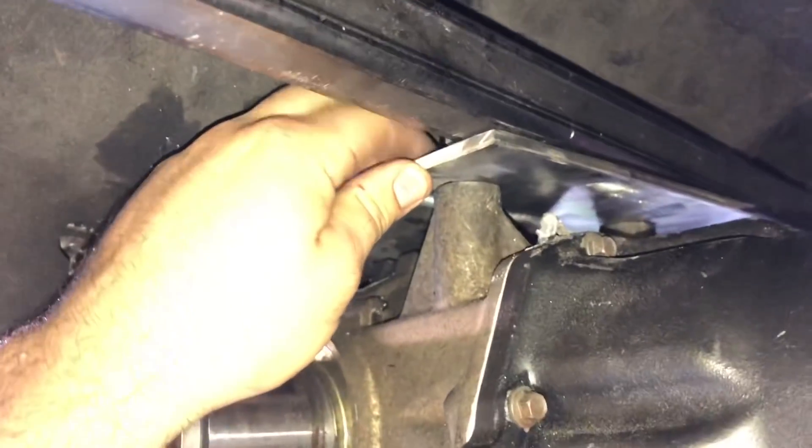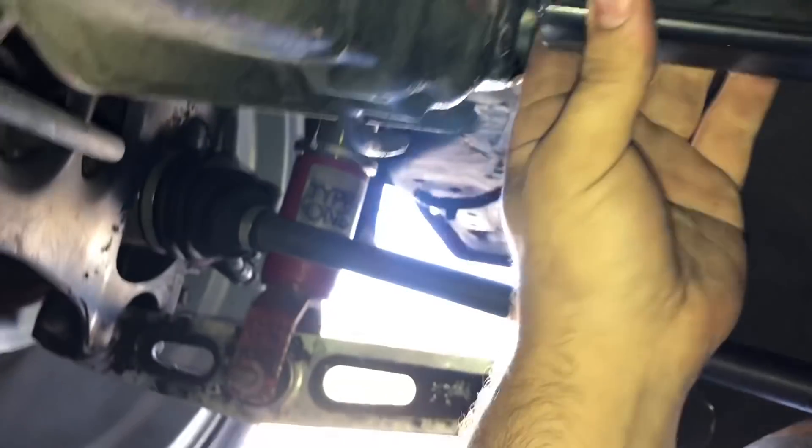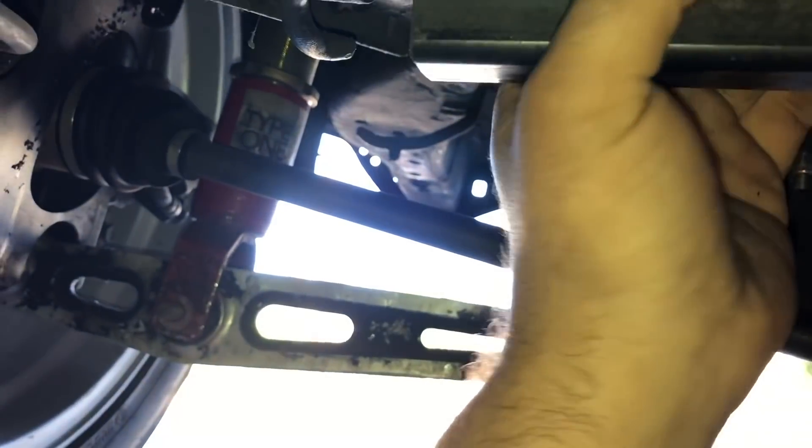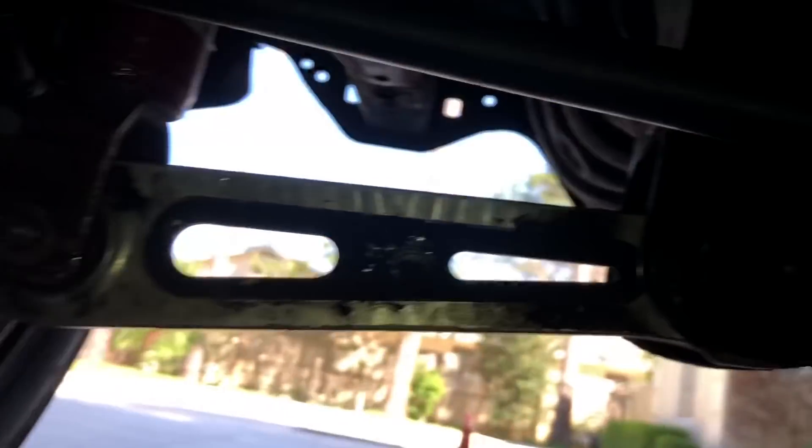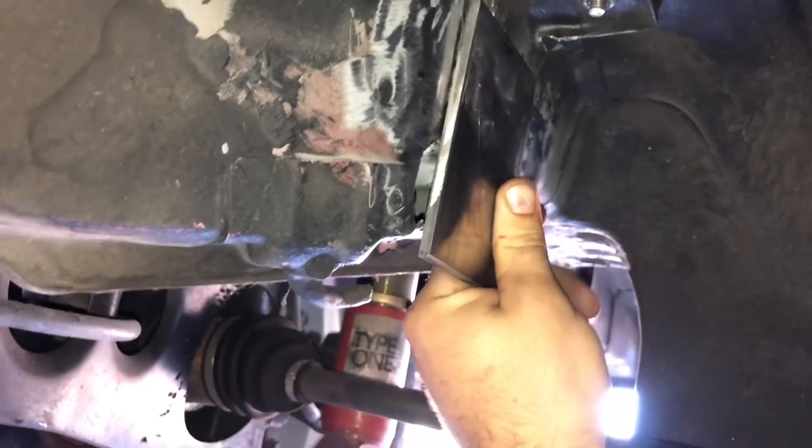It's loosely placed into location - plates are on, square tubing is in place. The original mounts from the other kit basically ripped the little weld area out, so I cleaned it all off. It's a tight fit right now - the other side is down but it butts up against there so you can't really fit anything in. I just have to cut a little bit off the ends of the square tubing, then weld on the nice thick plates. Since there are two plates, I'll take off just under two plates' worth on the end, which should allow for a nice tight fit. Then I'll clean up with a flap disc as necessary.